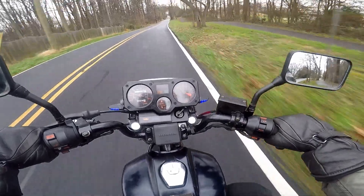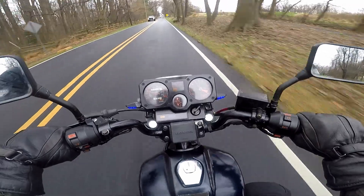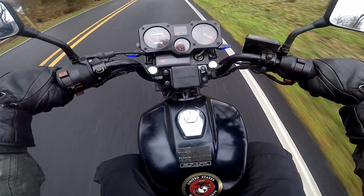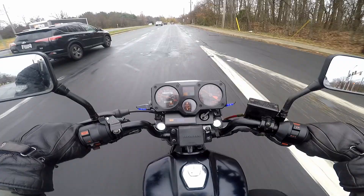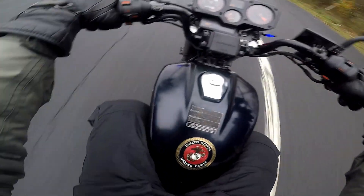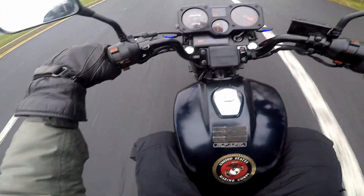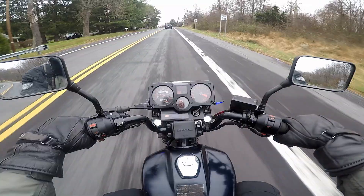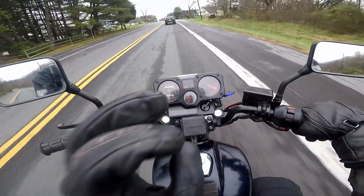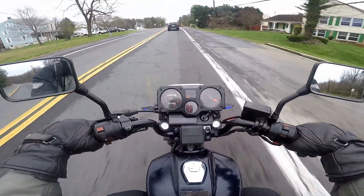There's definitely something with the carburetor. I'm not sure exactly what's happening but the bike is not perfect — there's a stumble. When I give it more gas it kind of dies, as if it's starving for fuel. I also have an issue with my speedometer — it's not reading properly, goes up to 25 miles an hour and stops. That could be the cable or the actual speedometer. When you open up the throttle fully, something happens with the carburetor as if it can't handle all the gas.